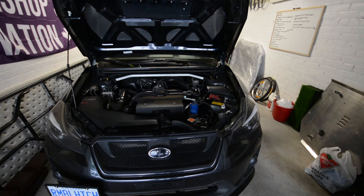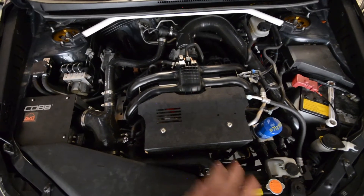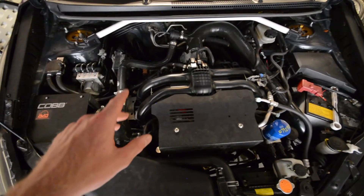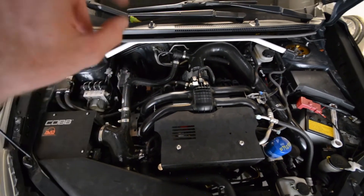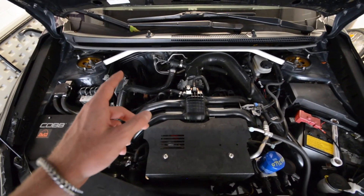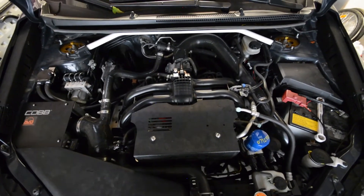In terms of oil, the car is currently running 5W-40 ENEOS full synthetic, but in the winter I'm going to switch back to 5W-30 ENEOS, again full synthetic. In terms of exhaust, I still have the same exhaust as before. The turbo kit replaces the header, but I do have a 3-inch catted turbo-back exhaust built by Matt at GT Custom here in the GTA. It's got a high-flow cat, two Vibrant ultra-quiet resonators, and a large-style Vibrant muffler in the rear. I probably plan on taking one of the ultra-quiet resonators out, putting it on a V-band so I can switch back and forth. The car is a little quiet for my taste, but it's actually quite nice for highway driving and it lets me hear the turbo a lot more.